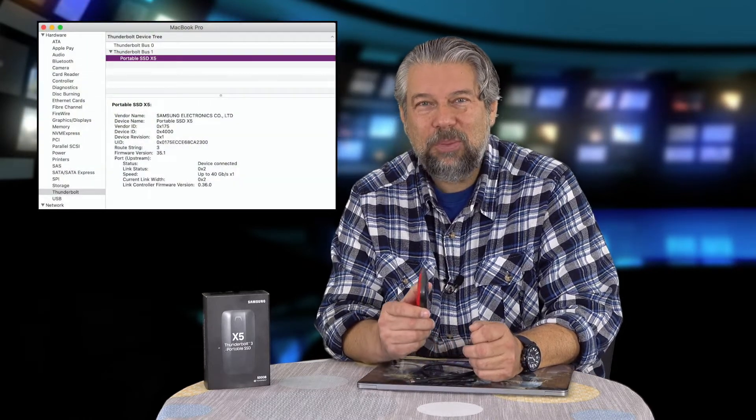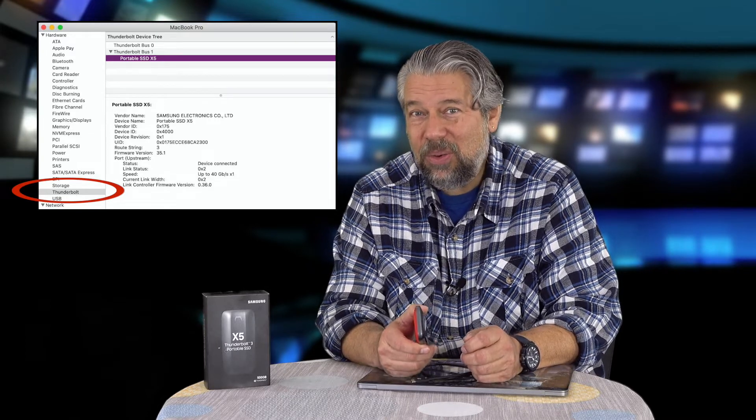Some people have not done so and they've been very disappointed or frustrated, understandably. When you plug this in — looking at it on the Mac side — you should be able to go to Hardware Report, which is off your About This Mac, and see in the Thunderbolt section that it's showing up as a Thunderbolt drive. You basically have two options: either it's gonna work or it's not. It requires Thunderbolt 3, but it's super easy to work with. This is a 2019 MacBook Pro, so all four USB-C ports are also Thunderbolt 3. Some devices might have specific ports for Thunderbolt; generally the manufacturer will indicate with a little lightning bolt and a 3. Know your hardware because that's going to make a difference.